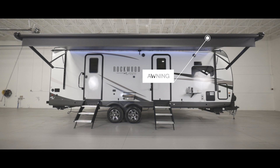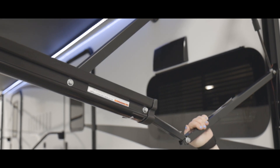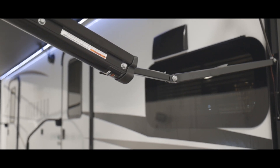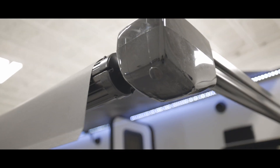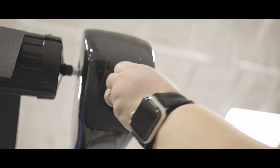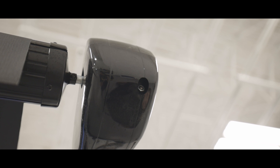As we keep moving forward, we come to your awning. To adjust the pitch of your awning, simply move the awning arms up or down — you can adjust both the front and rear arms, just watch your fingers so that you don't get them pinched. You will also find the awning manual override at the top where the motor is enclosed. Remove the black cap to find the crank point to retract your awning if you lose power.